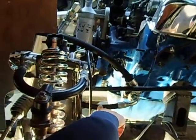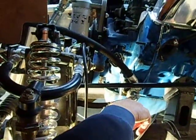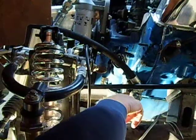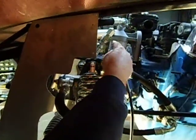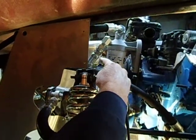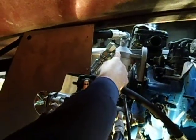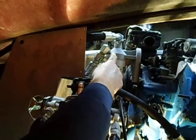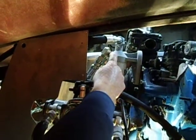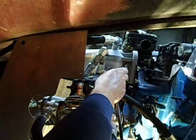This hose is about 24 inches long. We screw the 90-degree fitting onto the straight adapter. That 24-inch hose goes through the X-member on the frame, loops back up through, and we now have a straight end on the hose that goes to a 90-degree adapter, which takes us through into the oil filter housing — going in through the outside of the oil filter, which makes sense because that is the largest surface area of the filter.